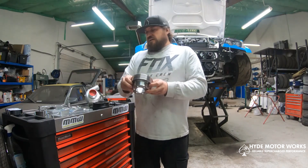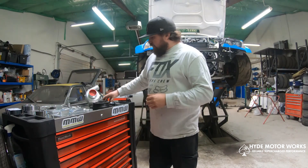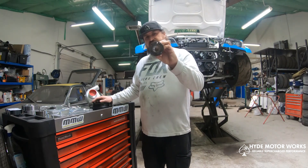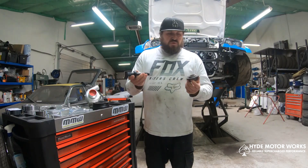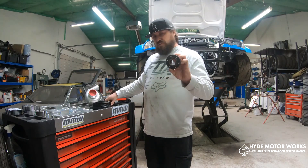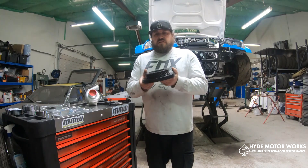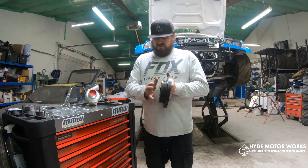In order to use this pulley we've made with a six-bolt pattern on it — which the M54 originally does not come with — we are discarding the original crank pulley that is on the M54 engine and we're going to be using the crank pulley system of an M52 engine. This utilizes a crankshaft mount with the same big bolt that the original pulley bolts on with. Because we're using this, we can design our own pulley using this six-bolt pattern. We've used the original M52 crank pulley, cutting off the part which originally drives the AC compressor.